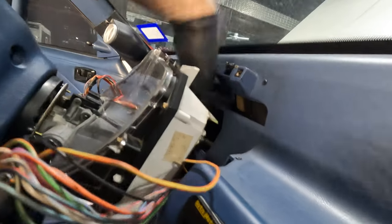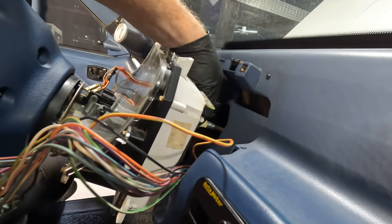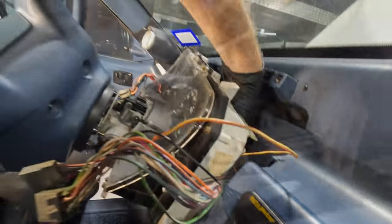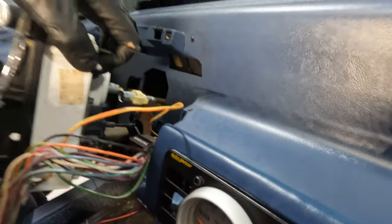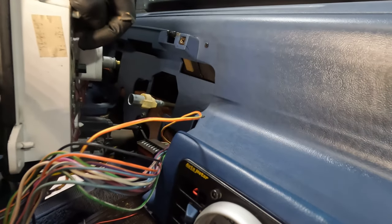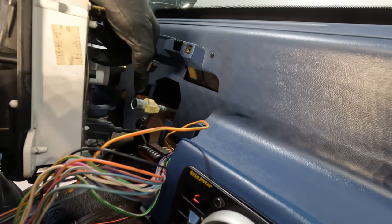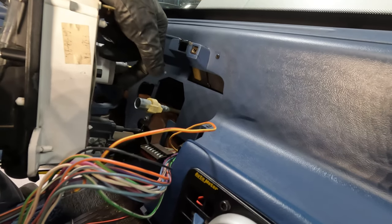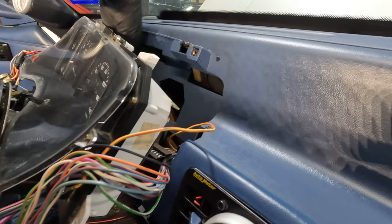Back to the speedo. All you do is push on either side of this connector and pull at a good angle. You can see — all you've got to do is push right there. See how that came out? So simple. You're going to feel very foolish if you've been doing something else for a long time, like I did. I'm talking about when I started ripping these things apart — I was 15 years old, and it took me until I was about 18 and maybe 10 part-outs later.